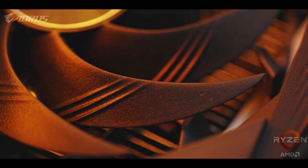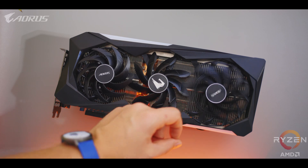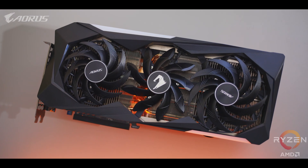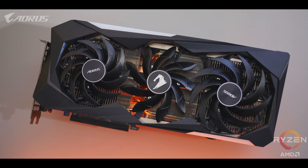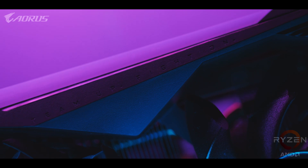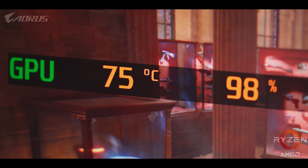The sizes and airflow direction are also a bit different from the previous generation of Aorus graphics cards. The outer two fans use a stack fan design, with one being 100mm wide and the other 115mm, and they both spin counterclockwise, while the center fan is also 115mm wide but spins clockwise. This reduces turbulence when the airflow of the three fans mixes, and it also increases static pressure so air can more easily get through the fins for actual cooling capacity. Check out these temperatures — they're super under control at load, and as for noise levels, this is a pretty impressive cooler design.